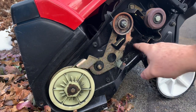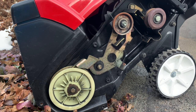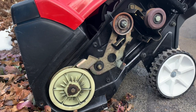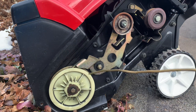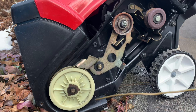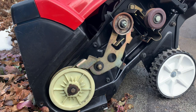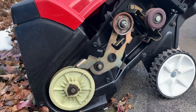So I'm going to put the belt on, then I'll blow everything off. The new belt has real good ridges in it. The old one had barely any ridges left — I'm surprised it lasted as long as it did. Let me get an air hose. I've got my blow gun with my long 1/8-inch brass tube so I can get into all the cracks and crevices and blow her out. It's just a nicer job when you blow it off. The customer looks at it and knows you did a nice job.